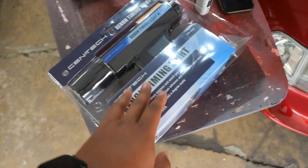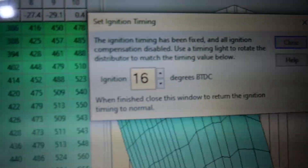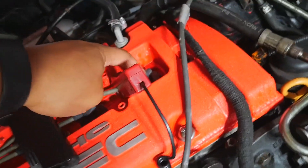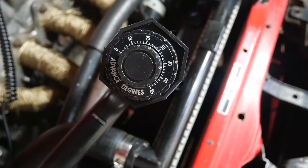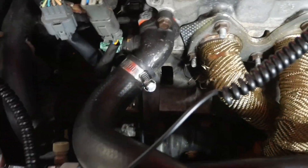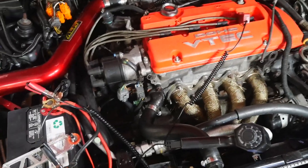I'll use this timing light I just bought from Harbor Freight. With the S300, open up SManager, connect to your computer, go online, and select 'Set Timing' — this is the equivalent of jumping the timing jumper. Start the car, let it warm up, then connect the timing light to cylinder one as close to the boot as possible, connect to ground and positive, loosen the two 12mm bolts so you can rotate the distributor, set the timing light offset to zero, and aim to set it to 16 degrees to match the computer.